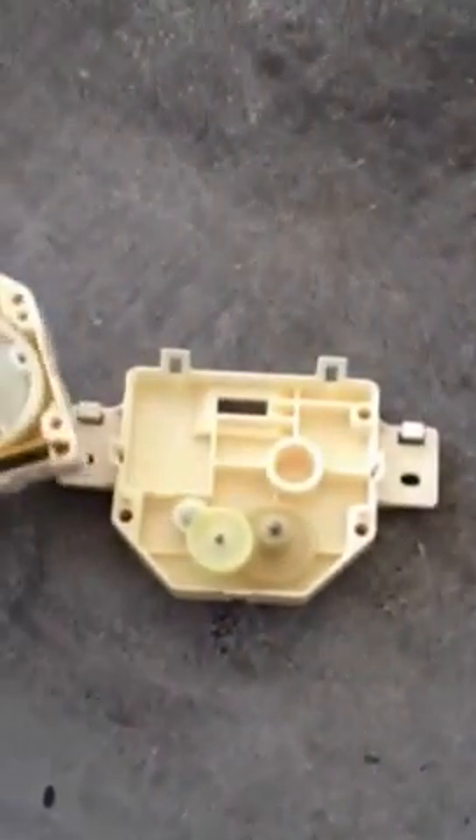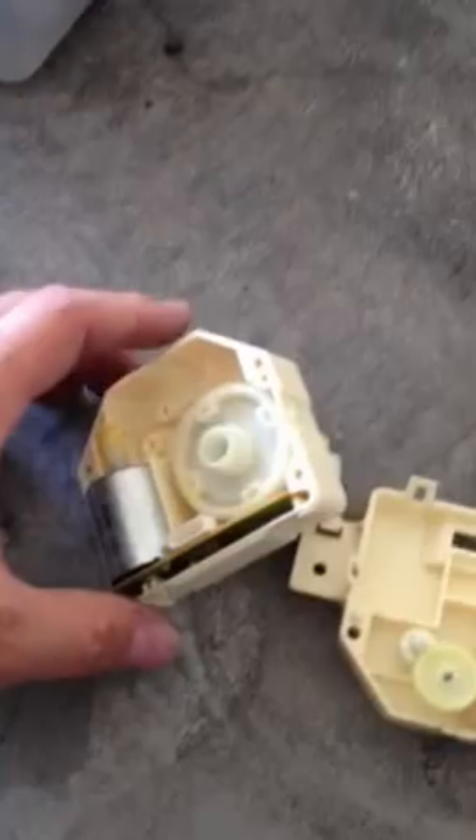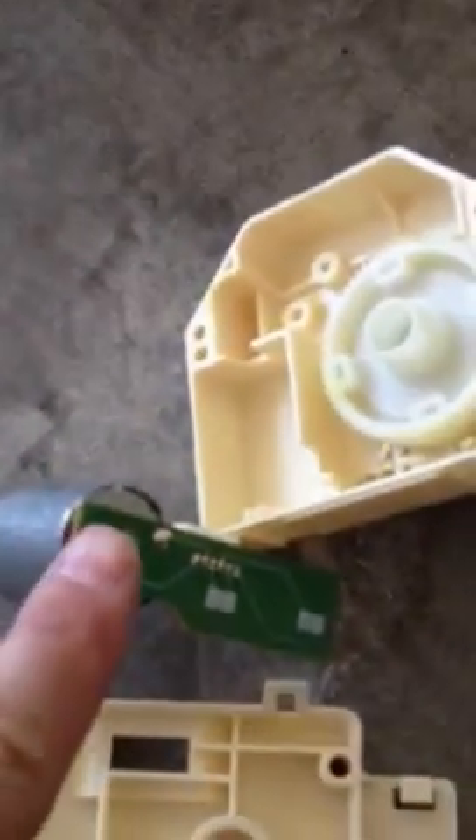So I will be taking it apart. I have the paper lift motor apart now and what I need to do is drill a hole right in the back here so I can feed my wires through there, because I'm going to hard solder the wires right to the motor. You can see right here is the motor and I will hard solder it right to these contacts here.